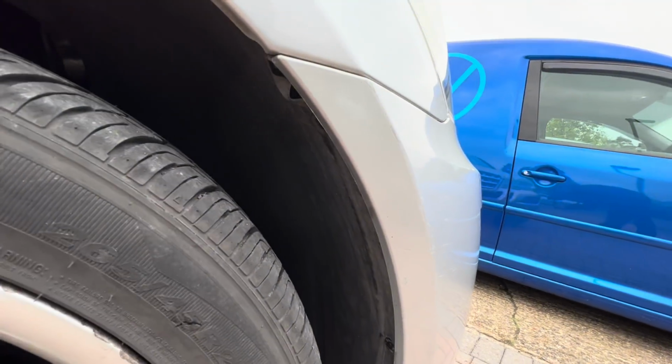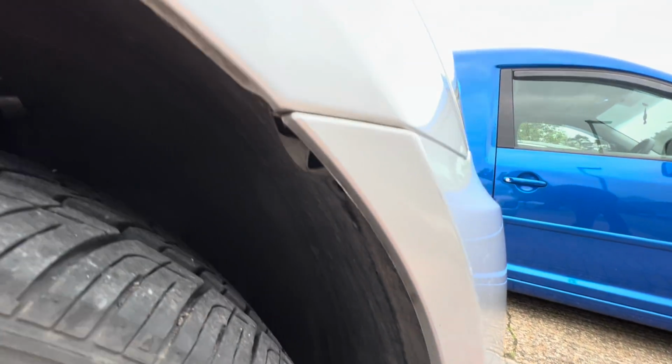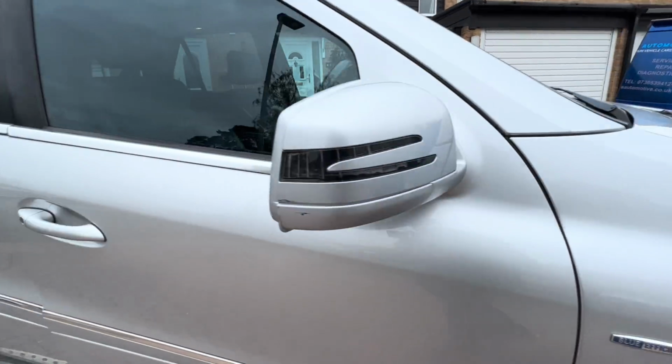Release the bumper as I explained on the other side, the same this side. So T20, those 3 clips out to get access to it. Then you can release this part of the bumper from the part with the wing here.